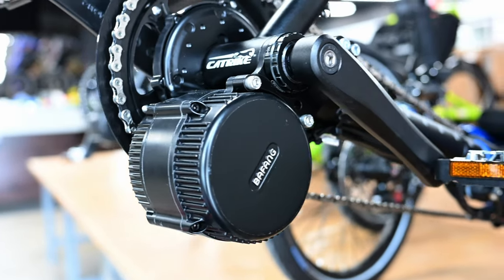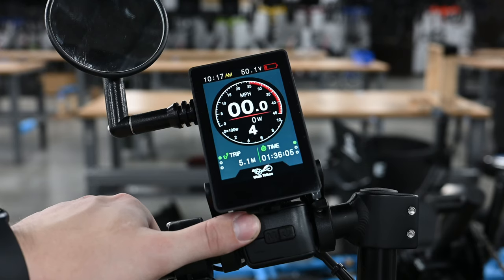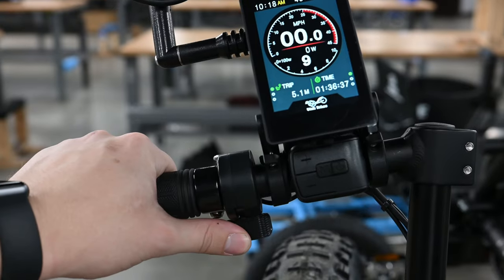Other ICE-provided accessories include fenders, assisted mounting bars, and much more. Through our UT Custom attachments, we also offer a boom-mounted Bafang motor. If 250 watts isn't enough power for you, the Bafang is the right option — it comes in three wattages: 500, 750, and 1000 watts. The Bafang is a mid-drive motor mounted on the front of the trike, with nine levels of pedal assist and a throttle, allowing for a relaxing and powerful ride. We have installed many motors over 250 watts on ICE trikes with no problems, but be aware that any motor installed on an ICE trike that is over 250 watts will void the ICE warranty. So if the warranty is a must-have, the Shimano might be the right type of motor for you.